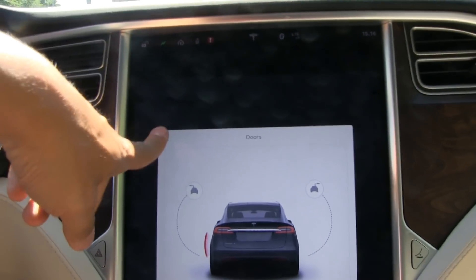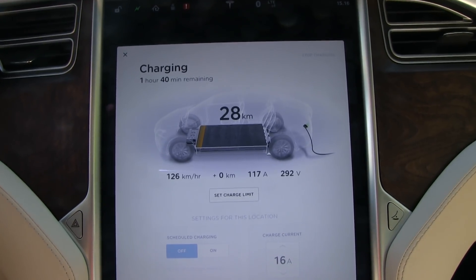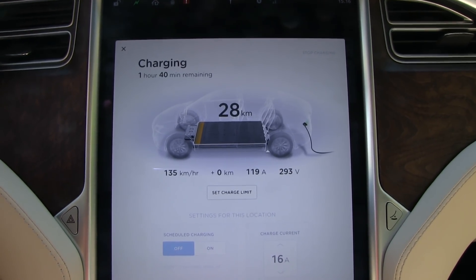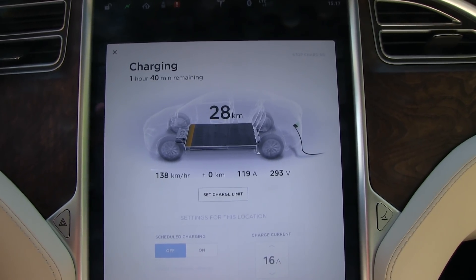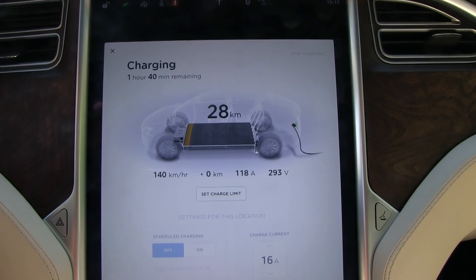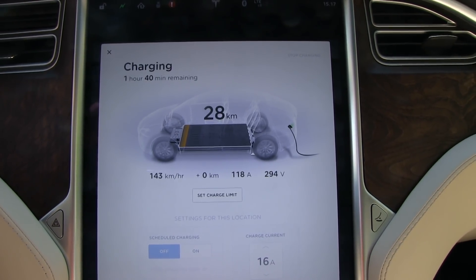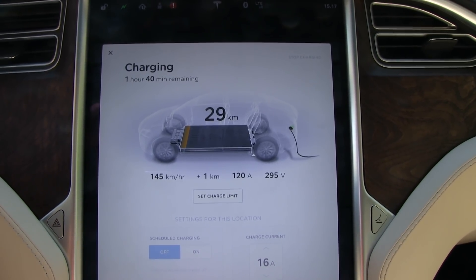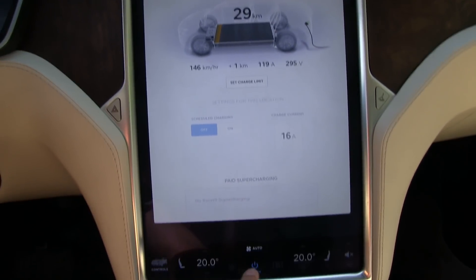What is this? This is good news! Oh ho ho — we are charging! Oh yeah! As expected, the on-board charger was faulty, but you can still supercharge or CHAdeMO charge, because when you use CHAdeMO or a supercharger you bypass the on-board charger and go directly to the battery.